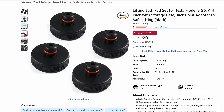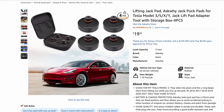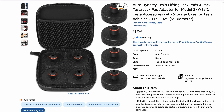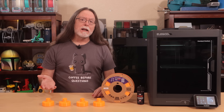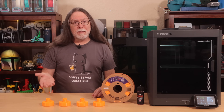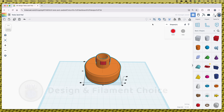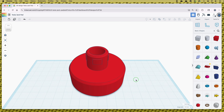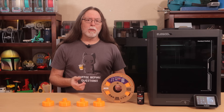You can buy a set of these on Amazon for about 20 bucks. But here's the problem: different Tesla models can have slightly different hole sizes. That means you can buy a set that fits too loosely, or one that's so tight it's a pain to pull back out. So I designed my own jack pad in Tinkercad, and instead of using a hard plastic like PLA or PETG, I decided to go with TPU.